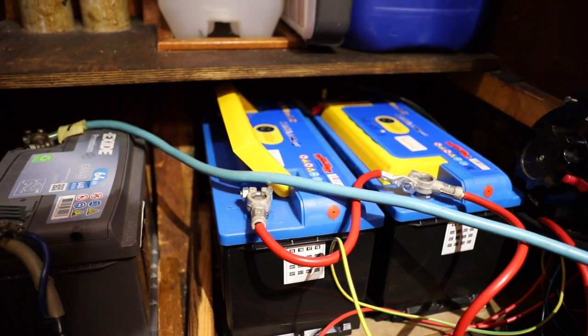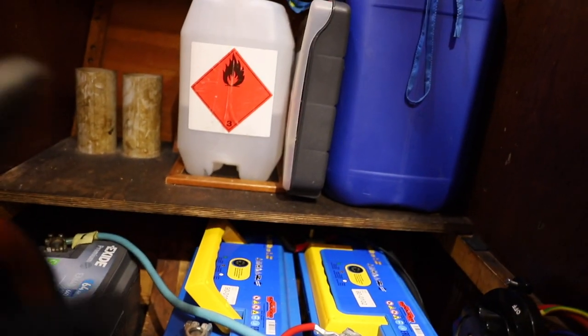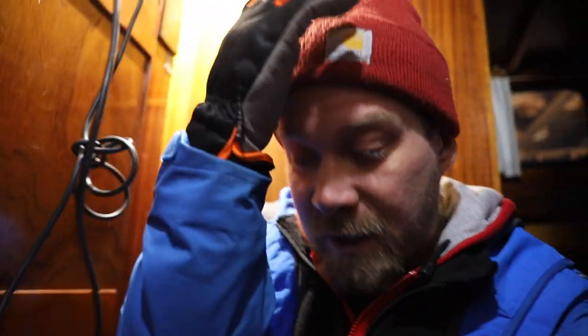And the electrical system in this boat is gathered up so that here's the solar panel charge controller that goes into these bigger batteries. And because I am disconnecting the batteries, I also need to disconnect the solar panels from this controller, because even though we are inside the barn over here, there might be some sun rays that get into the panels and bring charge into the controller, and it breaks up if you don't have anything where you can discharge the solar charging.